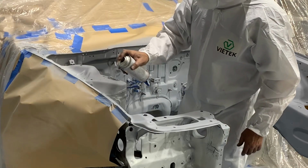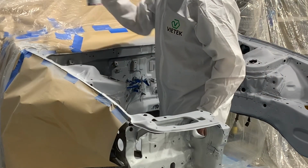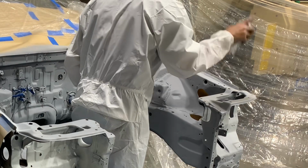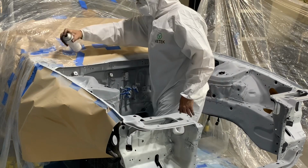Work your way slowly around the engine bay, laying nice clean layers of paint. When I do the base coat, I do 2 to 3 layers of the same area. This way I can ensure that the base coat is sticking to the primer, and then each additional coat on top again just adds more vibrance to the color.